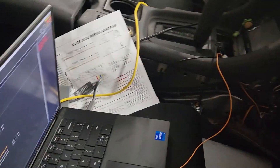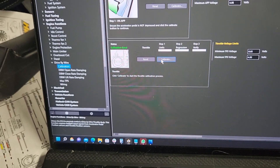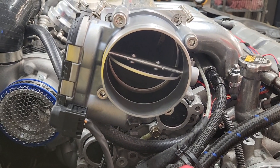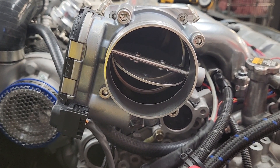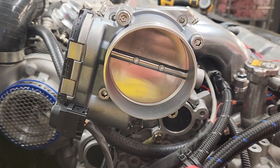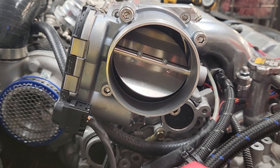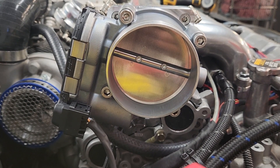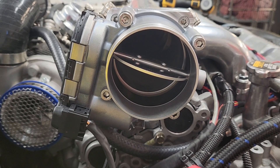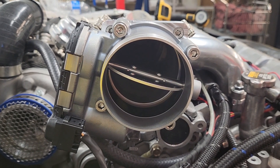We just hop in the car here — my laptop is just about dead, so hopefully we make it. We click 'Calibrate' on our drive-by-wire throttle. It's just going to go through the ranges and slowly close it and see how everything reacts. Haltech is really cool because it can basically do all the calibration and characterization of the throttle body on its own, so you don't have a bunch of PIDs to try to figure out on your own. You can use throttle bodies that aren't well documented, and the Haltech has some magic in their firmware — it can figure it all out.